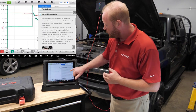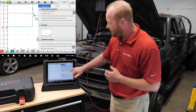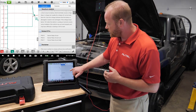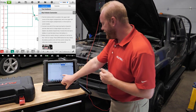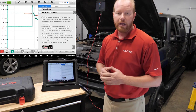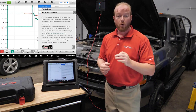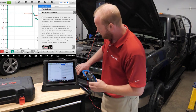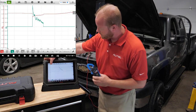If we scroll down a bit further, we're also going to see a real-life picture of what that would look like, an example of a known-good waveform, and lots of information related to DTCs. On the real vehicle connection screen, we need to make sure the current clamp is switched to the on position and set to the 1 millivolt per 1 amp range. The tablet will automatically configure itself for that specific range. We'll set our amp clamp to that 1 millivolt, 1 amp range, then slide the help information away and press Start.